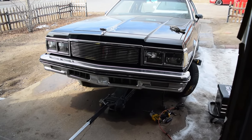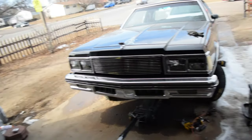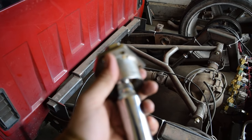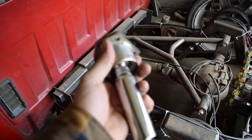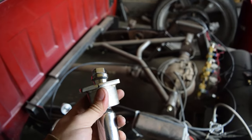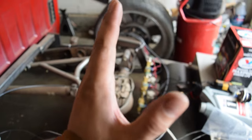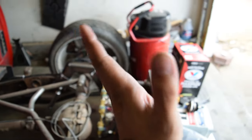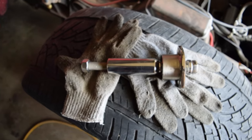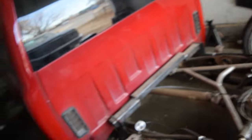I'm only running four bats to the front pump, so it's nothing too wild. We'll see how it actually sits fully locked up. You can see how this only has so much movement before it locks itself out. Some people — their cars lay too low, or the springs are too small, or whatever — and it tries to travel beyond that. And that's what supposedly causes the bolts to break. But yeah, let me get the grease. I got some red grease here, and then I'm going to bolt it on and show you guys what it's like on the whip.